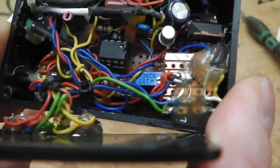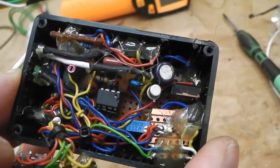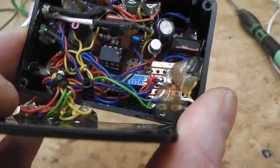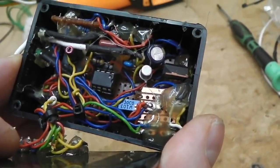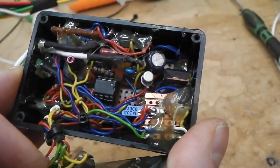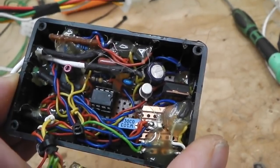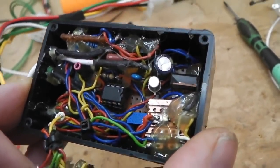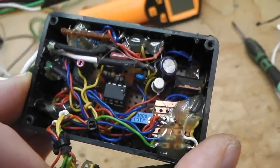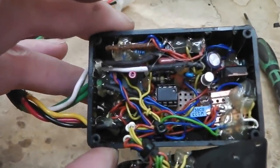I measured it the best that I could and laid it out, just like I said on this clip. It was built as I went along in terms of the other modules, like the timer and extra timer, and also off the back of the envelope diagram. You never really know how big the board's going to end up being, and you can break your Vero board to the right size, snap the Vero board to fit, but then you always think, oh, I need a few extra tracks there, or there's too many tracks, and then you file the board down. For me, this slotted in quite nicely. I must admit, and you'll probably see this more than I will, it starts to look really complicated really quick.